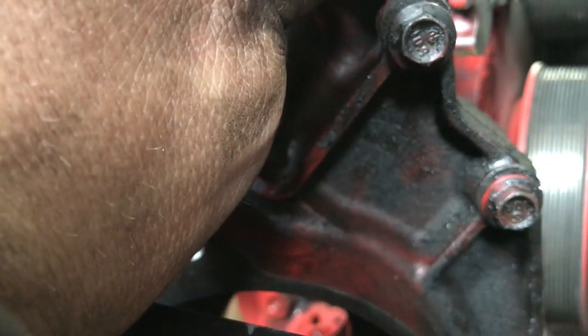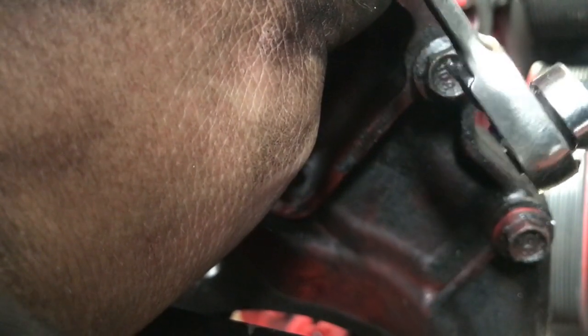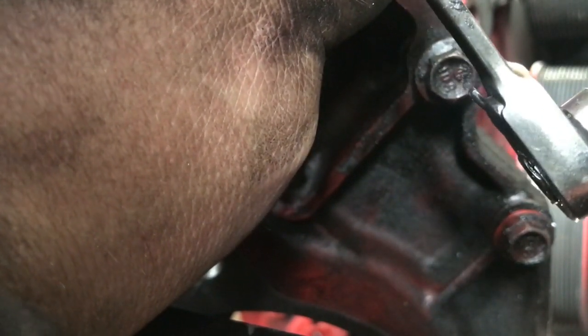You're going to use a thin wrench, 13mm, really thin, so I can get back behind the dampener. Or you need a flex head wrench. Gear wrench, they make them too. I have one, but I couldn't find it. But this worked really well. Put a socket with an extension on it, get leverage, and that's how I got it out. These bolts right here.